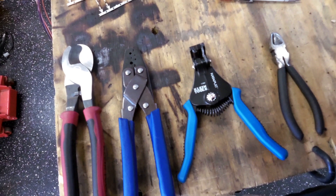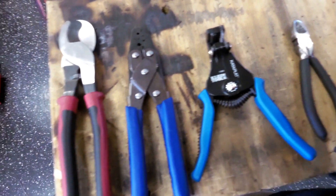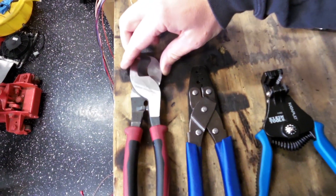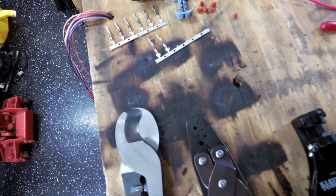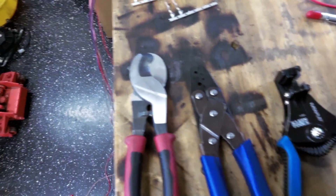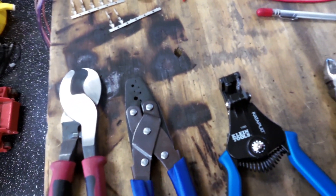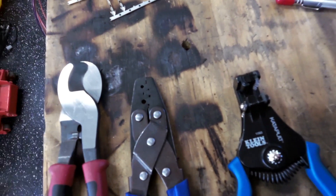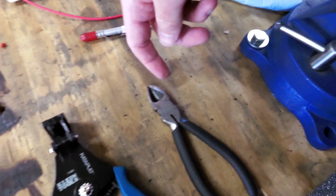Here are the tools I typically use to assemble these connectors — just a small set, mainly the three on the left. Starting on the left we've got a set of wire cutters. These aren't your typical side cutters; they're large gauge cutters. You can get these at Home Depot — these are Klein brand cutters, really good especially for cutting bundles of wire, nice clean cut. Next up we've got the crimpers themselves. These are the low budget crimpers you can get from Summit. The holes indicate these are for WeatherPak or MetroPak. And then we've got the strippers and the side cutters.